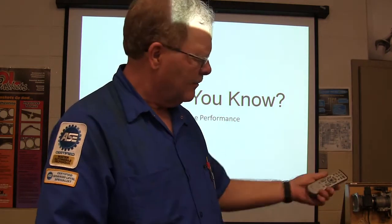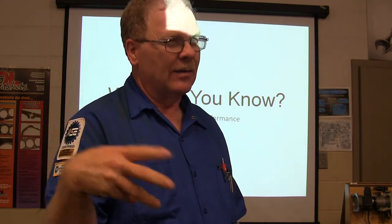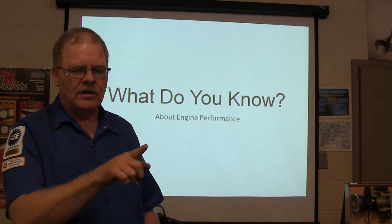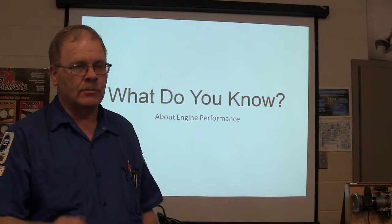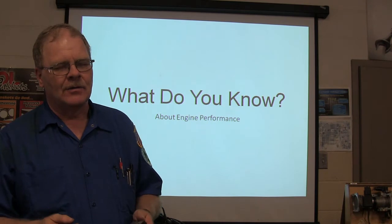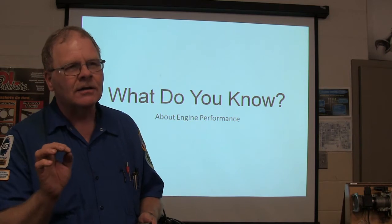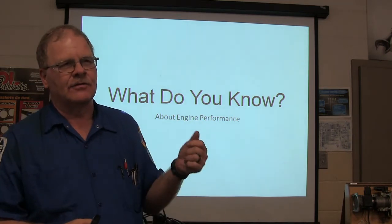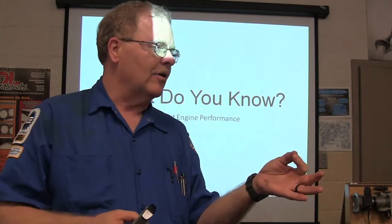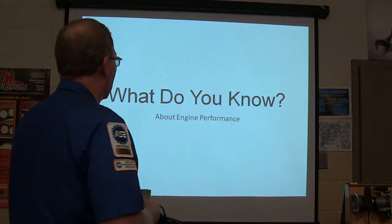And I got to thinking, and what I knew about that is, whenever you're turning the key to the start position, the old ones used to have a cold start injector that would wet the manifold. And that particular one, whenever you spun it, I think it was pin 21 was supposed to get hot when you were starting it, and it would double pulse the injectors to start it up. Well, it wasn't double pulsing the injectors, and when I went to pin 21 and checked it with my test light, it was dark when I turned it to start. Then I looked back and there was a fuse that somebody had pulled out of one place and put in another one. The only thing wrong with that car that made it start hard was the fuse was in the wrong place. And that was a fairly easy fix if you understood the car.